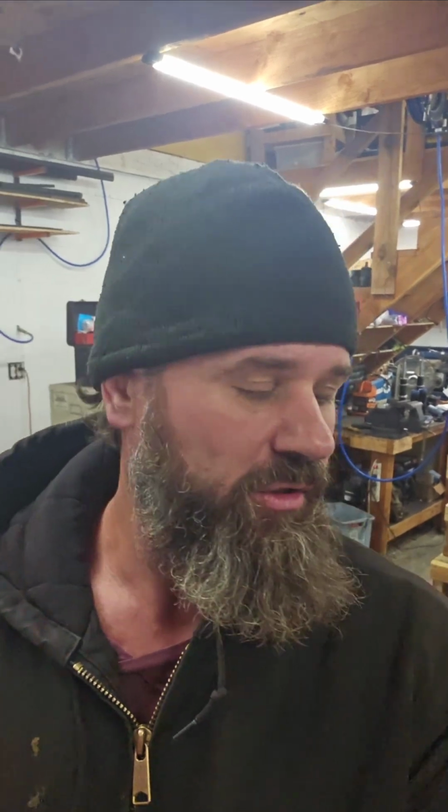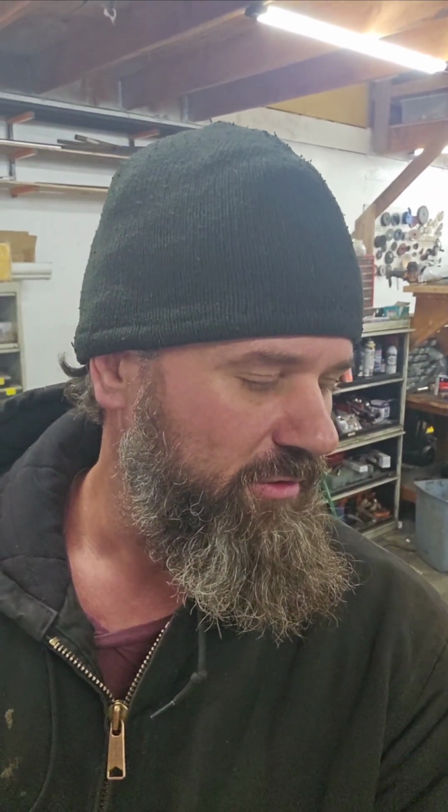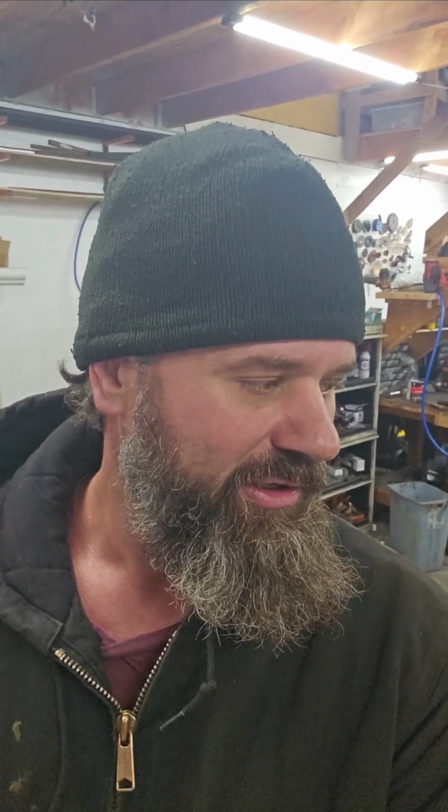Anyway, I know that was kind of a quick and dirty and pretty sloppy presentation of it, but I hope that helps somebody, because like I say, I just spent a week on it, and anybody who's spent a week on a single problem on getting a car running, it'll drive you nuts. So if you have a points ignition BMW, it's super simple. Just take care of those. You don't even really need the wire from the starter. So it's really like 2 wires and your points. Hopefully, it's not a big deal. It just took me a week. So how big a deal was it? I don't know. Hopefully that helps.